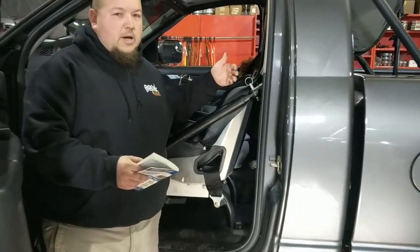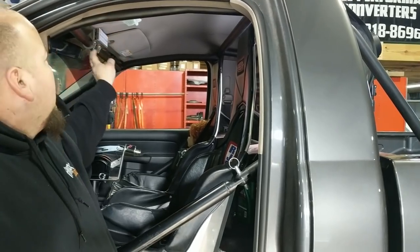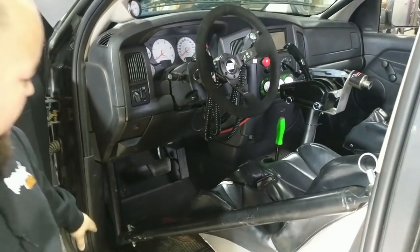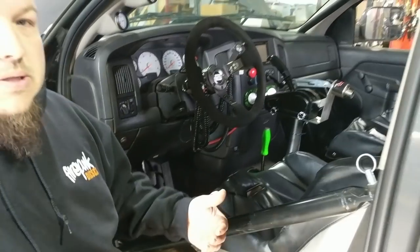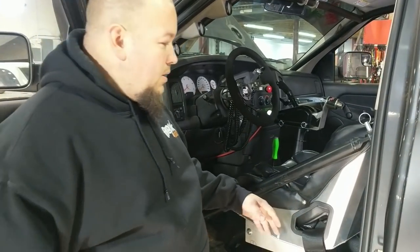Going over the basics — the difference between a roll bar and a roll cage: the roll bar had six points of construction. The roll cage adds the overhead bars, the roof bar, and front down bars. All of the front down bars need to go to an outrigger welded to the frame. One key change in language: a roll bar states it can be bolted or welded to the frame, but an 850 cage can only be welded — it cannot be bolted to the frame. Everything needs to be welded via an outrigger.